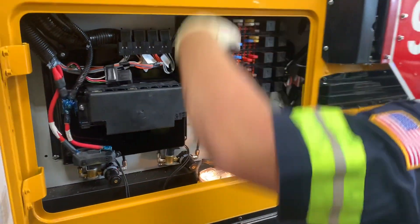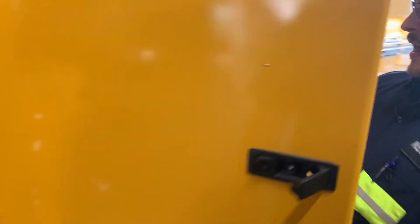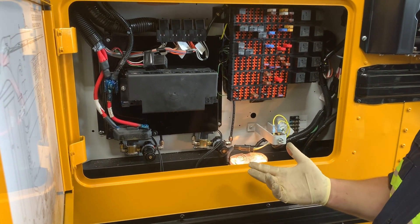You can actually catch it from the inside looking in — you can see the light sticking on. So what we're going to do is just bump that out, make sure that it doesn't cause an issue because this bus sitting for long periods of time with that light on will actually kill the battery.